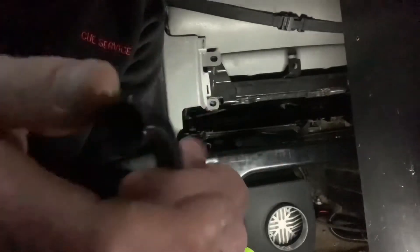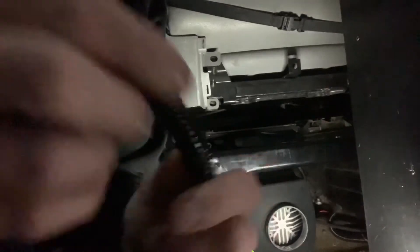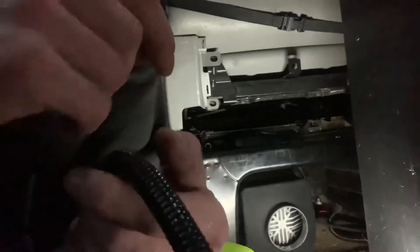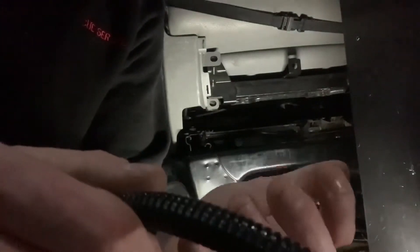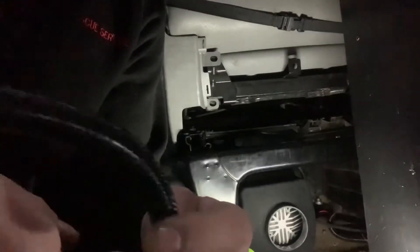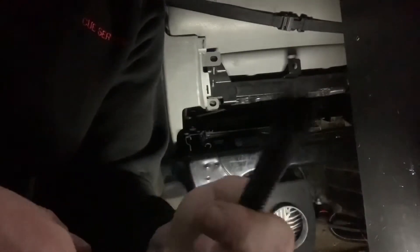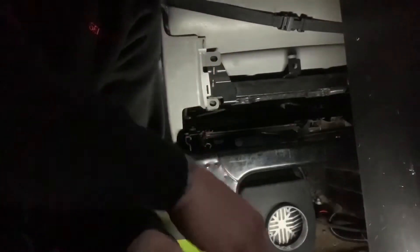This is plastic conduit - flexible, with a slit down one side. You thread the cabling into it. What I tend to do is use this on all the different systems in my van - I've got it on my light system, all my lighting wires go down one, the sink goes down one, the leisure battery split charge feed goes through one, and the heater is in one. It gives it an added bit of protection from chafing.